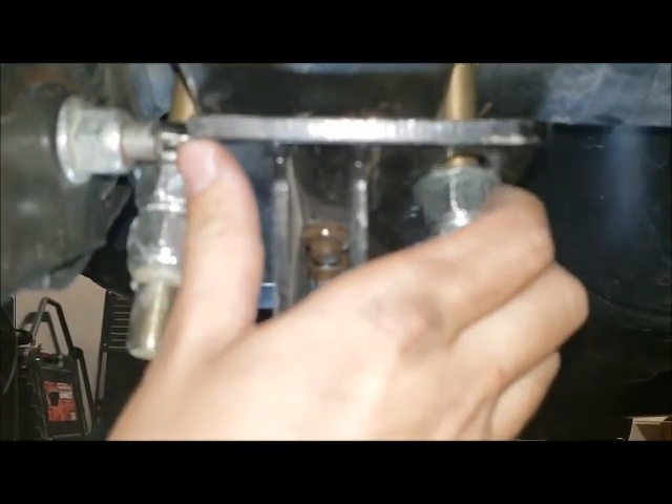On the driver's side I'll show you that. Here we are back on the driver's side — I'm gonna show the bottom brackets and what I had to do. You cut the bracket out a little bit — fits the shock in there. The only thing I had to do to this bracket to make it fit on my IHC kit — they do offer a flip kit of their own — but you just gotta line your nuts up and then file just the inside down a little bit. Stick a file through there and file it down just a little bit to get the nuts in there. On the driver's side you just have to cut your little notch in there.